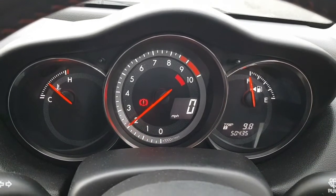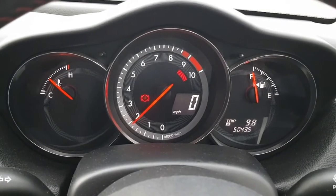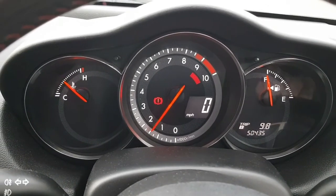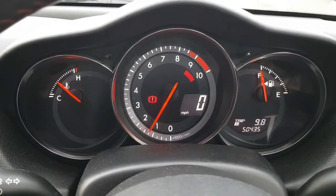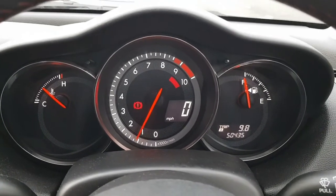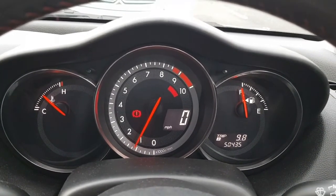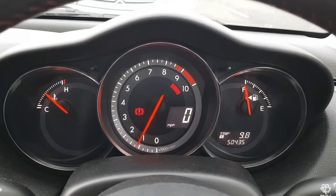And there we go — it briefly shoots up. Now I'm not touching the throttle pedal there. My foot isn't on the throttle pedal at all, I'm not touching anything. So, quite unusual behaviour, and obviously a starting issue. But the car fires readily enough when it's hot, which tends not to point to compression. But obviously I'm willing to be guided — having spent what I've spent on the car, I'm willing to be guided by those who know better.